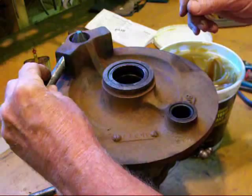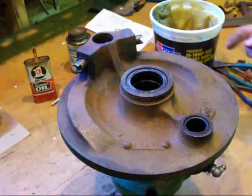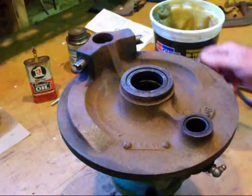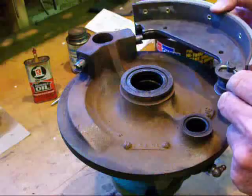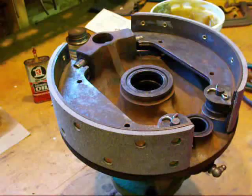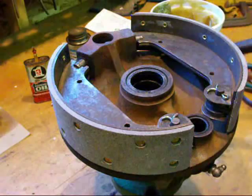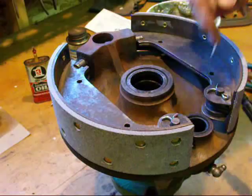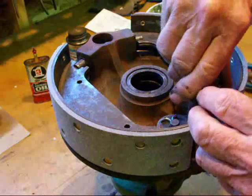These hardened pins go in here. I screwed this adjusting screw all the way down — it was a little more than finger tight so I had to use a wrench. With the pins in and cotter keys bent over, we lay the two shoes on with clean hands. Then we're going to put the cam that actuates the brake in there, using just a little bit of grease on that shaft hole — not very much because we don't want any to come out later.